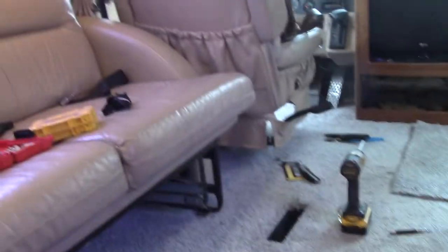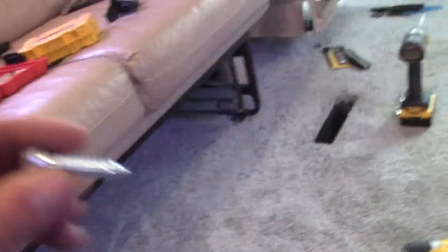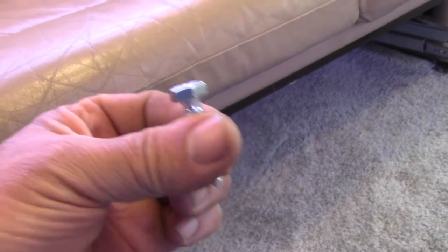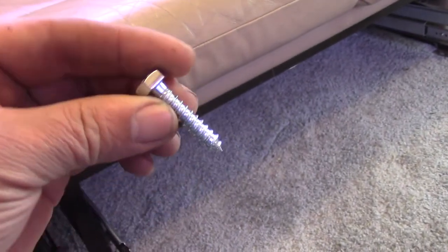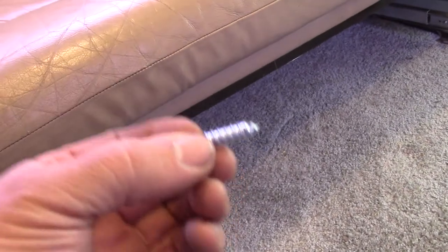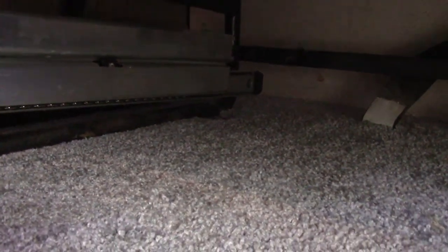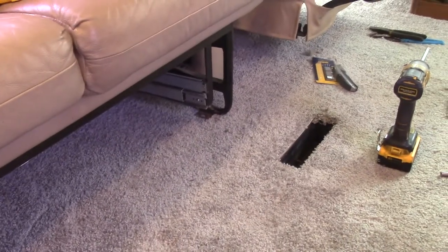I kind of want these couches bolted down securely and I have challenges with that because I have to drill down through the carpet and through the plywood using a pilot bit. These are old school lag bolts, and I got these shorter ones with plates flat to the floor because I want full contact of thread in the plywood. I think that will hold for a long time. The other ones were kind of weak because they were rusty — once they get rusty and wear around in a hole, it makes the hole sloppy. I already drilled one of the holes in the back corner.